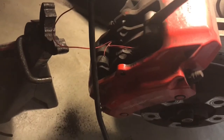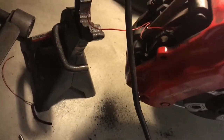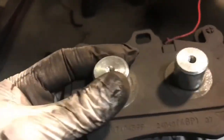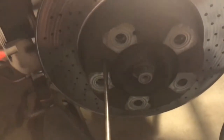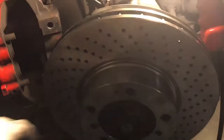To decompress the brakes, get something big like a large flathead, put it between the pistons, and just turn it — you're good. The old pads have little clips that go inside the pistons but the new ones don't, so I'm just gonna install it without them. My Evo didn't have them either — they're pretty much the same Brembo brakes. To take off the rotors, just take off the screws right there and it'll come right off. Sometimes you have to hammer it off.